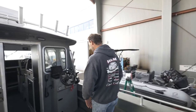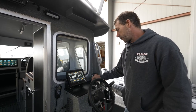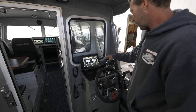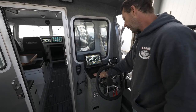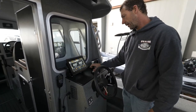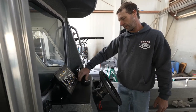Over here at the aft station, Garmin's going to be our display for Yamaha here. Squeezing the joystick in was very tight with the plotter and the controls — they were way over here — so we made a little plate, scooted over as tight as we could get comfortably, and got the joystick in to allow for full clearance of it.